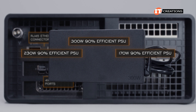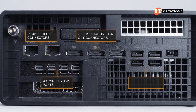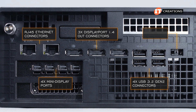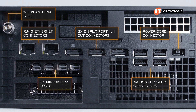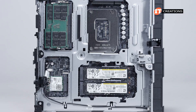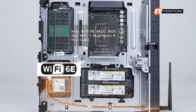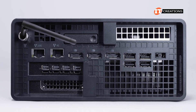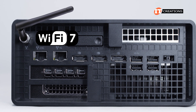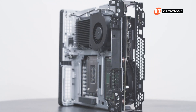Power requirements depend on how the system is outfitted — you will need a large PSU if you intend to install a GPU. You get four more USB Type-A ports in back with 10 gigabit per second data transfer rate, and an antenna for Wi-Fi next to the power connector. Pulling out the internals reveals the wireless LAN module: an M.2-style card providing Wi-Fi 6E and Bluetooth 5.1, with Wi-Fi 7 also supported. That slot is dedicated for Wi-Fi connectivity.